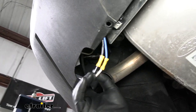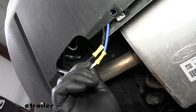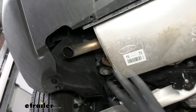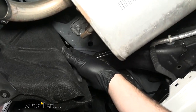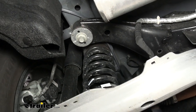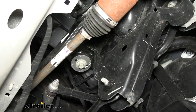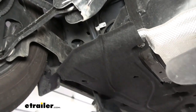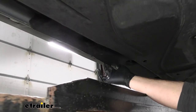We connected the black wire to the black wire on our seven pole and the white wire in our duplex to the blue wire. The way we ran those up — we'll eventually zip tie those to something safe up in our bumper. You want to stay away from anything hot or moving. We ran our duplex up over above our spring, above our other body mount, and then we took all these fasteners out of the underbody panel and you're able to just slide the wire up inside of here.